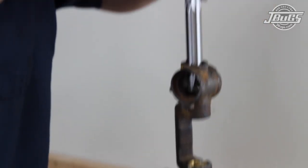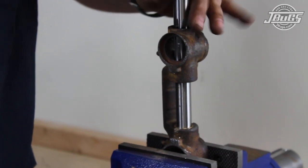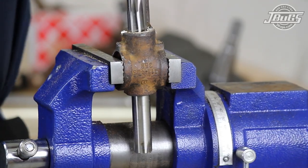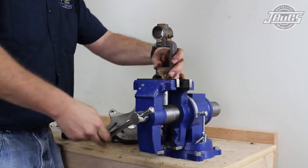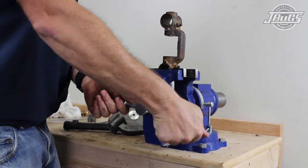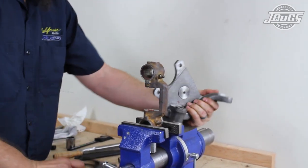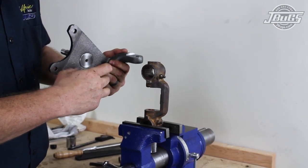Now our one specialty tool, the VW224 king pin reamer, is slid through the upper bushing and aligned with the lower bushing. We spin the reamer with a crescent wrench and light pressure through the upper and lower bushings. All shavings are thoroughly cleaned from the spindle carrier and it is clamped upright in the vise, using a socket below it to keep it from sliding through. The original alignment washer is tapped into place over the pin on the new disc brake drop spindle, followed by a new greased nylon bushing and a new dust cap.